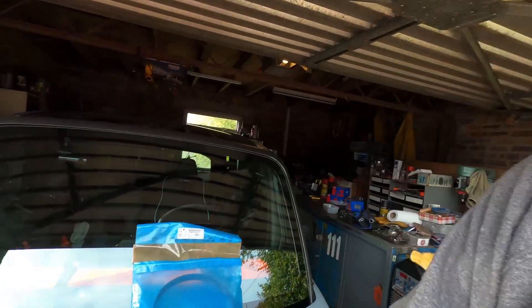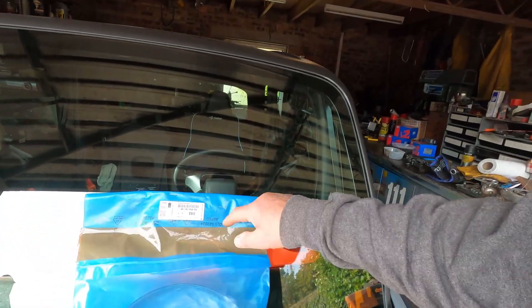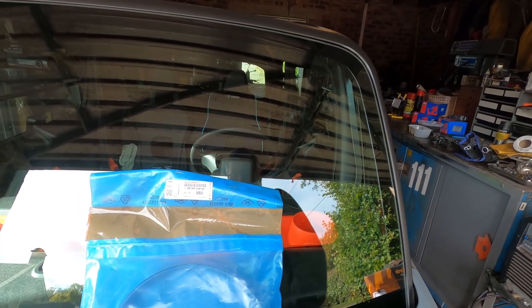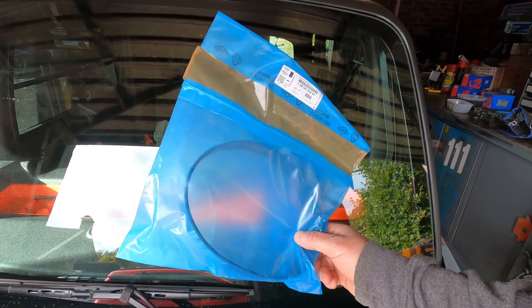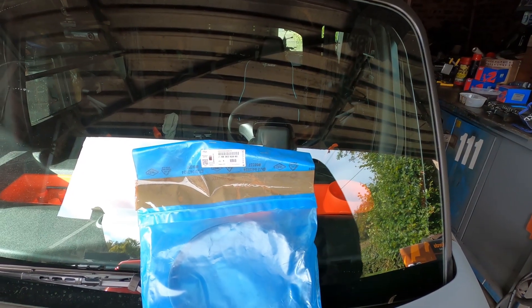It's that time of year again — need to get some maintenance done to the Citroën AMI. The drive belt's been squealing for at least a year. I've tightened it up as much as I can and run out of adjustment now, so I think the belt needs changed. Last year I bought another belt from Citroën; it's been lying about all year, so I'll get that fitted shortly.